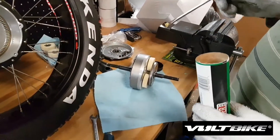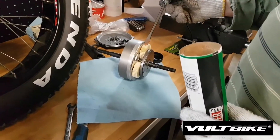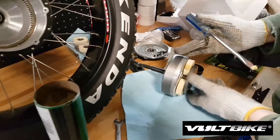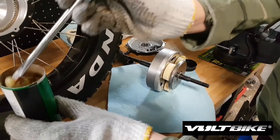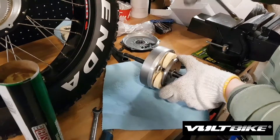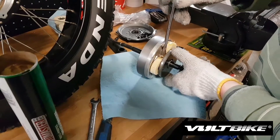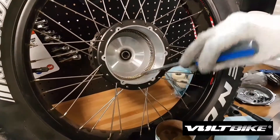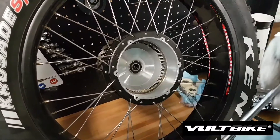It's a good idea to add some grease on the gears since they come brand new. Use a multi-purpose grease, normally available at Home Depot or Canadian Tire — just apply some gently. You can also put some grease inside the hub.